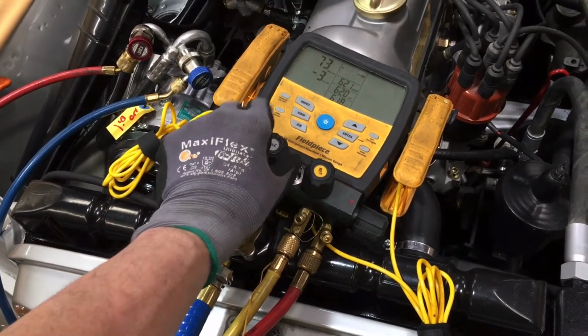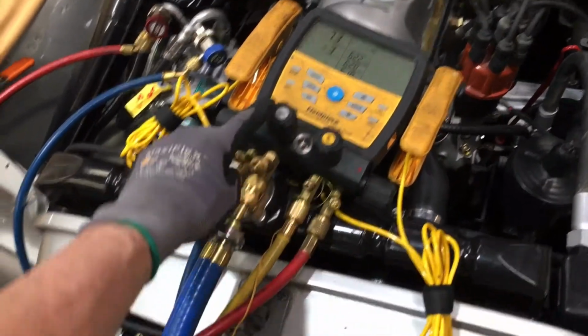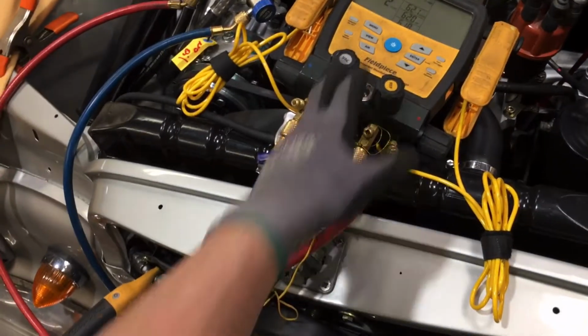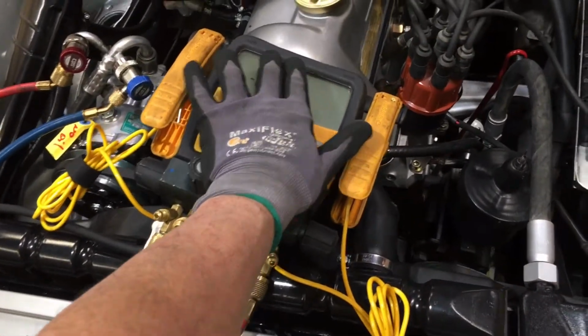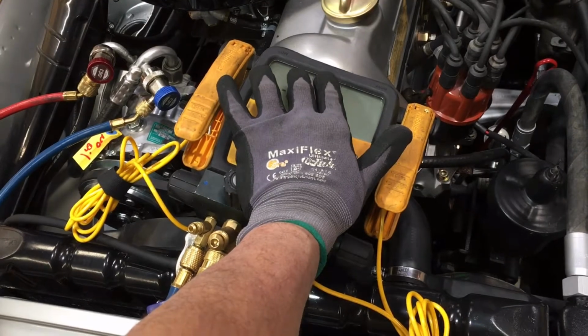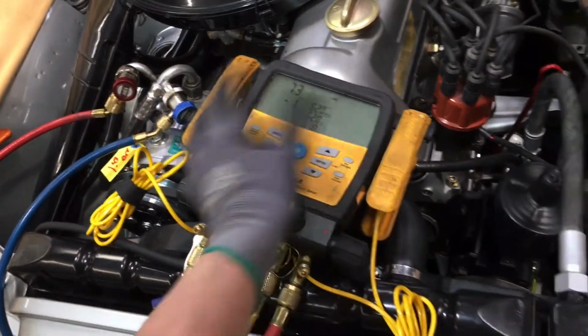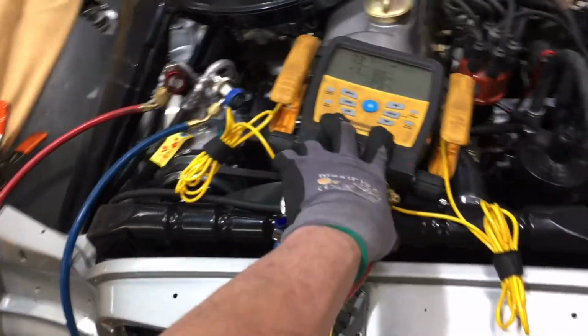And so what I have already done, just to check, was I turned off the vacuum port to the vacuum pump, and the microns come up to 376 microns. That's excellent. That means moisture removal is almost complete. Actually, that's above regular standards.